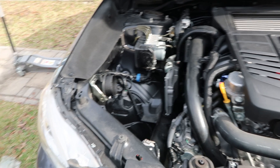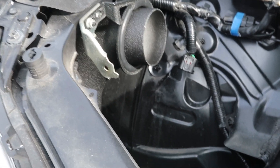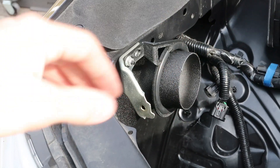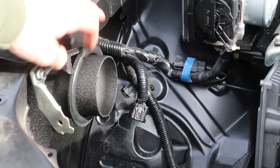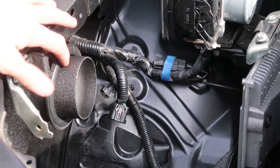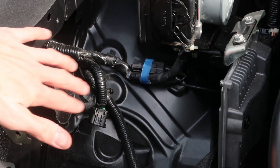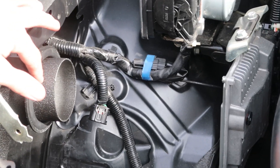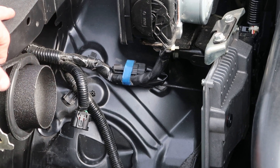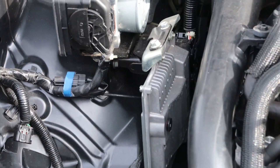After a little maneuvering and some help, we finally have it on. One important note: the stopper that comes with this requires the smallest rubber piece from the kit, trimmed to fit. Get the intake piping positioned first, then fit the stopper in — it will not go in once everything is already assembled. Once that's done, this thing is very secure.